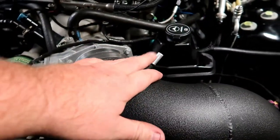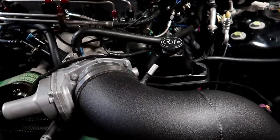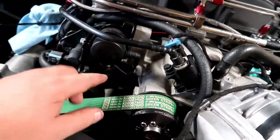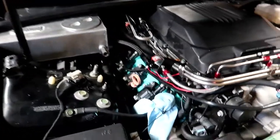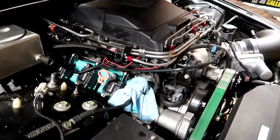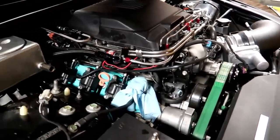The only thing I'm concerned about is maybe this air breather for the crankcase. It's theoretically supposed to connect to a little port down here - kind of way up, I wish it was down below, but whatever, we'll make it work. Got a rag over it so no debris gets in there. Trying not to run it without a breather system. I do have the vacuum hooked up to the lower plate just to get some pressure off of it - I just hate for a seal to do something stupid.